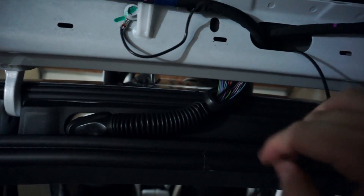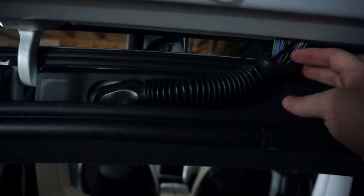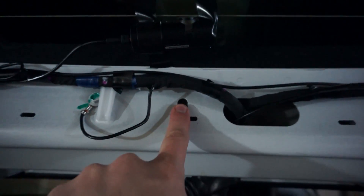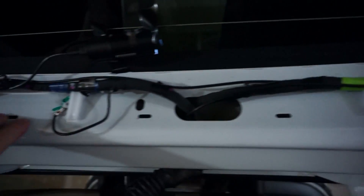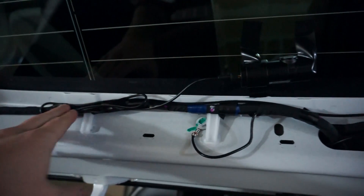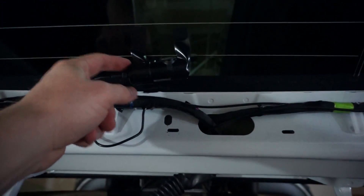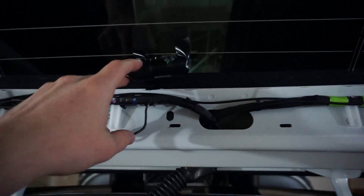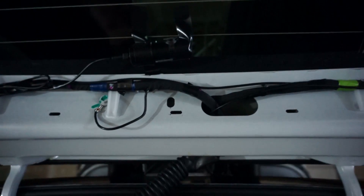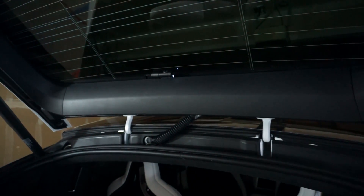After you fish your video cable all the way through, you're going to want to reattach the conduit at each end — this conduit protects the cables since this area is technically outside of the car. The hole should be dead center, so you want your lens lined up with that. One suggestion is to tape the camera in the spot you want it before taping down the wires — that way you'll know how much wire you have. I just have to put the plastic cover piece back on and then do the adhesive for the camera to lock it in place. Here's the back camera — I reinstalled the trim and attached the camera to the back window.